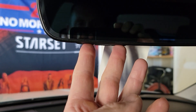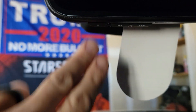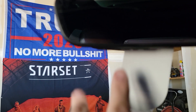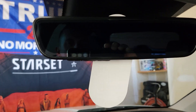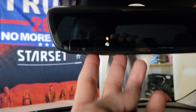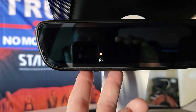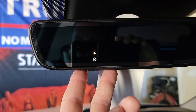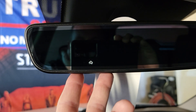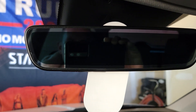Before we get started, we're going to clear the garage door opener's existing codes. Push up on the two outer buttons — you'll see buttons one, two, and three. You don't have to use all three; just program the ones you need. You'll see that little light start orange, and when it starts flashing really fast green, that means the codes are cleared. If you're trading in or selling your vehicle, you definitely should clear your codes.